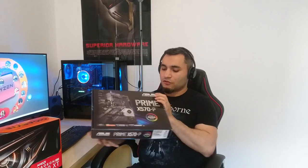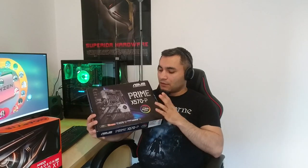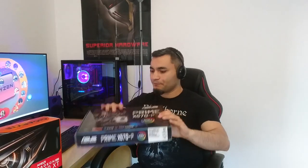In this video, you will see how the computer running next to me was built. The main components installed are the AMD Ryzen 5 3600 current generation CPU. The motherboard is the ASUS Prime X570P. Now you can get a cheaper motherboard and save a few bucks, but the reason I went with this one is to make my rig somewhat future-proof.